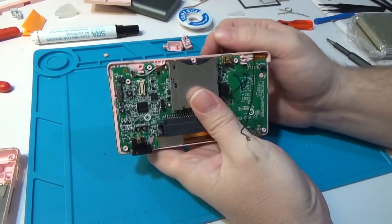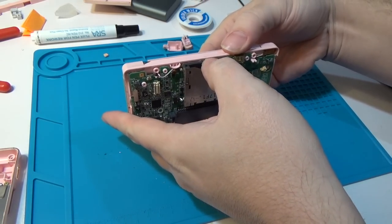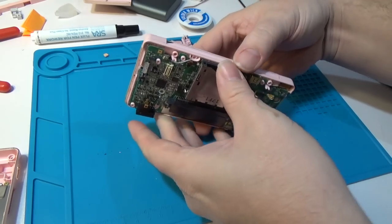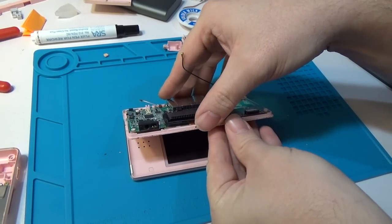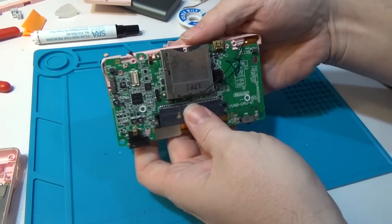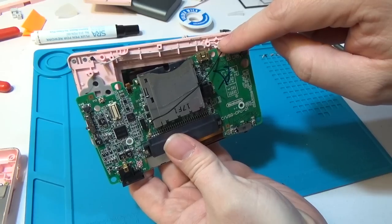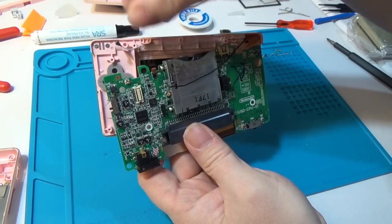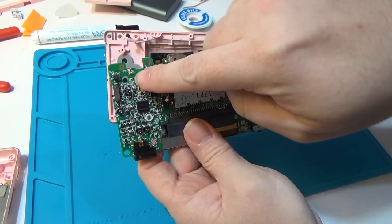The trick is making sure which direction the microphone cable runs - there's a specific orientation. There are great pictures online, and I probably won't be able to provide as good a description here. So let's pull this cover off - reach under here and give the screen a little push, start disengaging the board from the case. Now with that disengaged we can really see underneath it - the microphone cable runs down between the peg and the piece for the right bumper, underneath the screw hole, and has a special track that runs all along the side. Ultimately it comes right through here and reattaches.